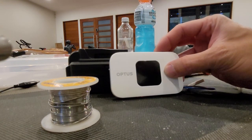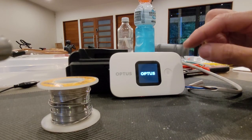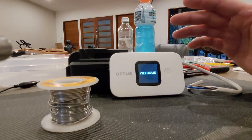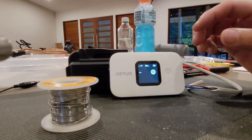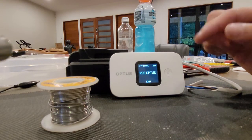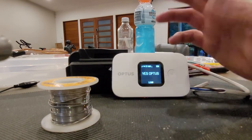As you can see, the buck converter is now working. Turn it on and this unit should start working just as if you had a battery in it — let's give it a couple of seconds to boot. I think this hack will probably work for most of these tiny little units. What I really like about it is I can leave it connected to my secondary battery in the trailer, and I can have internet on the go — my niece could use a Wi-Fi tablet in the car, or I can use it for work.